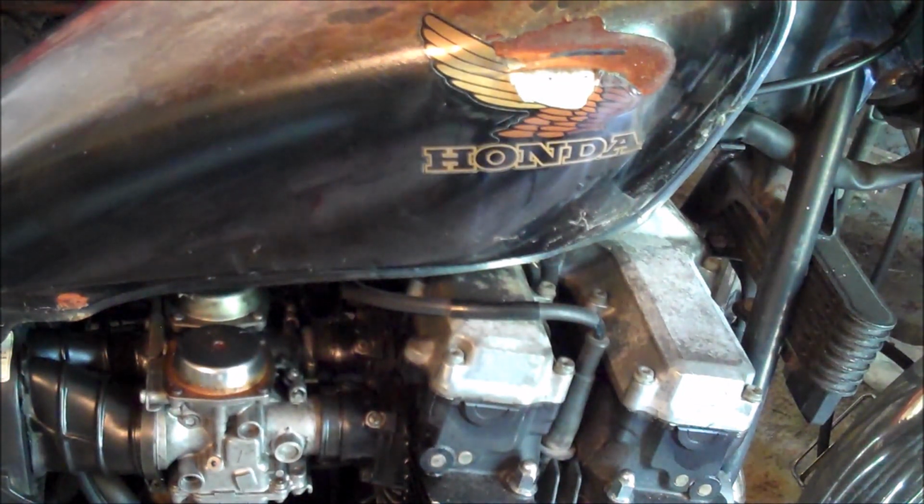Second, you've got a variety of gas lines which deliver the gas to the carburetors. This goes through the petcock, which is over here. Your petcock and your gas line, which is right in here. If you have old rubber, old clamps that don't seal as well as they used to, or you have bad seals in your petcock itself, it can leak from out there, right here, or actually out this faceplate right here. I see that a lot.